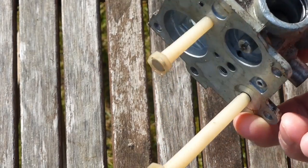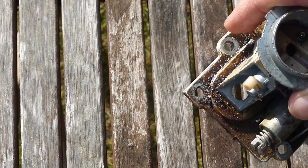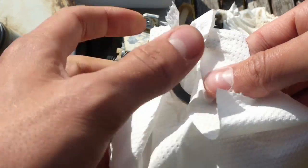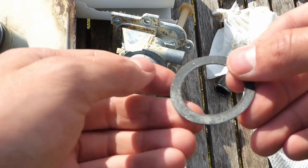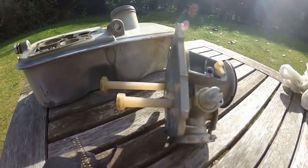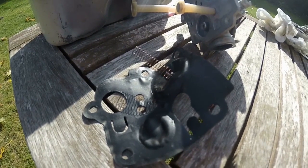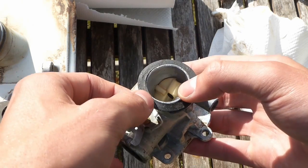You can see there's a lot of dirt in there and it definitely needs a good clean. The previous owner clearly didn't get to the stage of actually cleaning the carburettor thoroughly. However, they did take the carburettor off previously — the diaphragm wasn't stuck, the bolts were not tight, and one of the screws is actually missing. The carburettor gasket is now cleaned, and the whole fuel tank and carburettor are fully cleaned using carb cleaner to completely flush the whole system through.